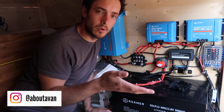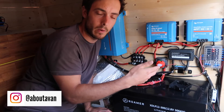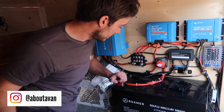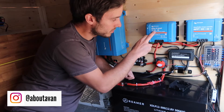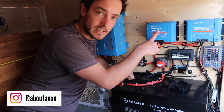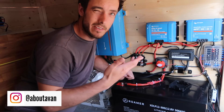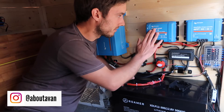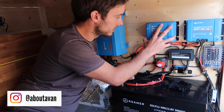You can get a screen for the front if you want to monitor the system hourly or daily, but I personally prefer the Bluetooth option — it's personal preference. This is an Orion TR Smart 12/12/30, meaning 12 volts input from the engine, 12 volts output to the battery, and 30 amps maximum. I've run these before and they actually output more than 30 amps when needed — I've seen up to about 35. Really good value, solid unit with a massive heatsink and no noisy fan.